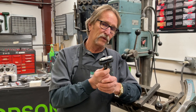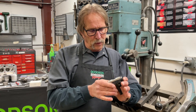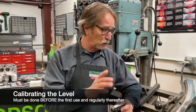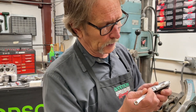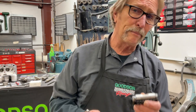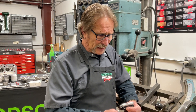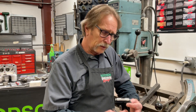And that's what makes this valve guide level very unique. Back to the point of calibration: if you've got a perfectly leveled machine, that's probably the easiest way to start, because you've got these little adjustment bolts. We have to move these up and down according to which direction we need that bubble to go, because our result is we need this bubble — this valve guide level assembly — to repeat itself every time we turn it 180 degrees.